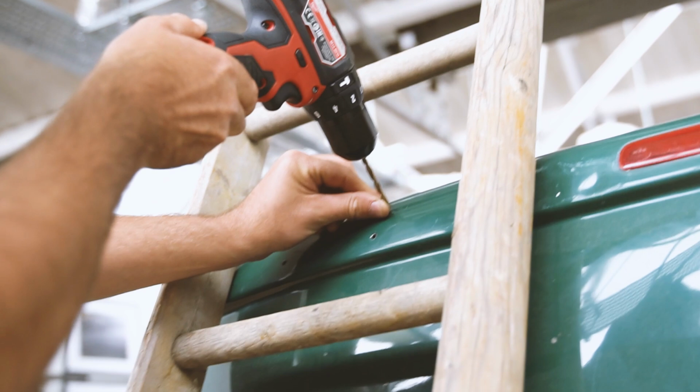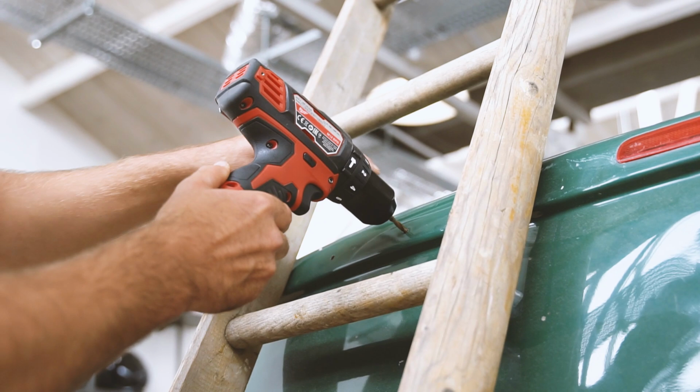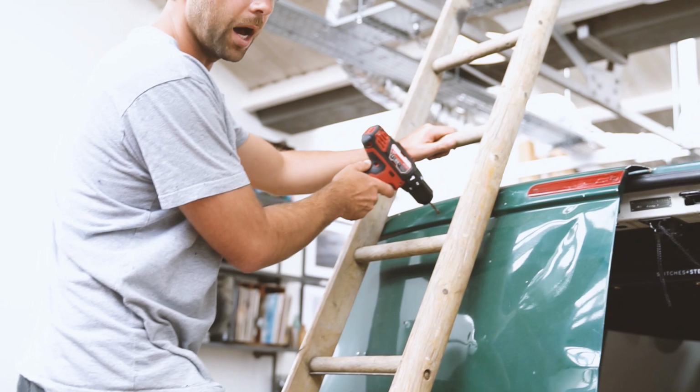So what I'm getting at is, if you go in there as you just did, we're in now. If I kept drilling at that angle, it would glance off the inner steel and skip off up the hill. But actually, a bit of angle gets you in. Angle is going to be your friend here. And you don't need to sweat about making this hole bigger, because it will do that. But you don't have to be any bigger anyway.